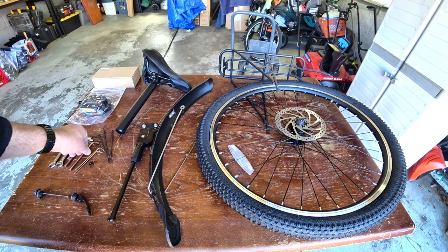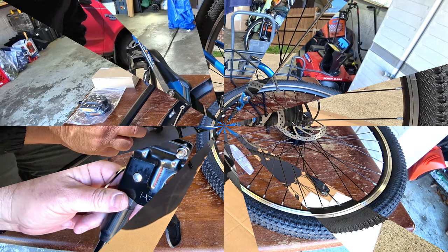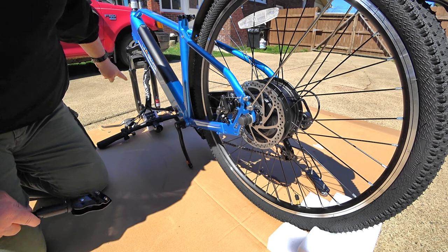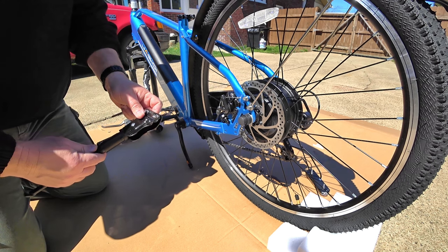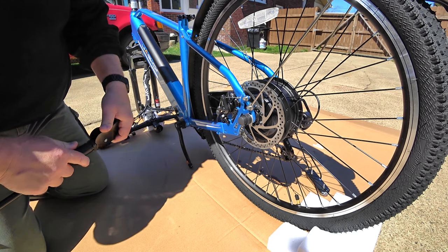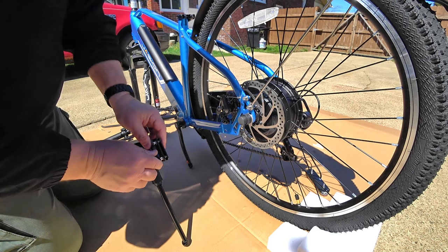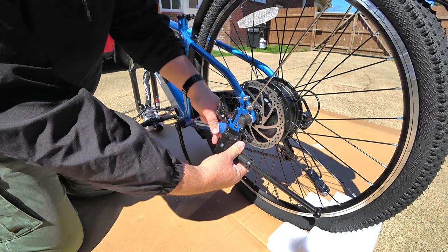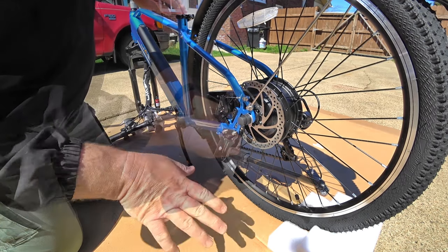The first thing I'm going to do is find the wrench — that fits the kickstand — and we're going to install the kickstand first. The reason is because once we put the front wheel and tire assembly on, along with the fender and the headlight, those all go on at the same time. We want to make sure the bike has a way to stand up at that point. So I'm going to collapse the kickstand, remove the pre-assembled bolts and washers, put that on either side of the bike frame, then reinstall and tighten them. Now the kickstand is ready to be used.